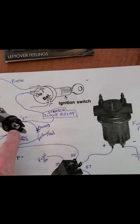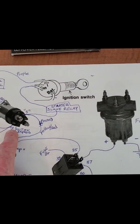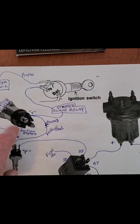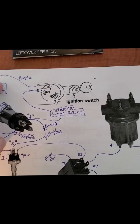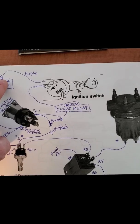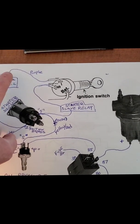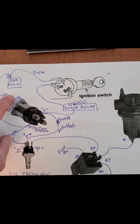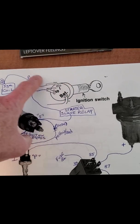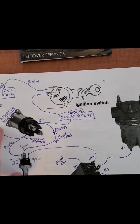There's also a purple wire that runs down through the engine harness and ends up attaching to the starter solenoid on some engines — that's the I-terminal for ignition bypass. If you do not have that wire, then simply find a wire that's purple on the coil and you're going to have to tie into that. The alternator also has a field wire which is purple — that also could be a place to tie in if you can get to it without cutting into the harness too bad. That is going to be the first part of getting power out of that ignition circuit.